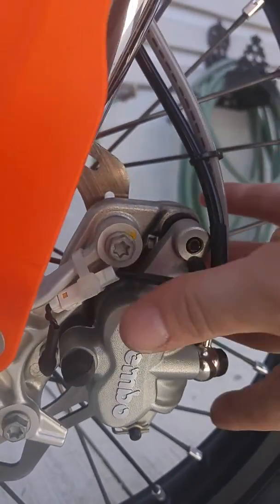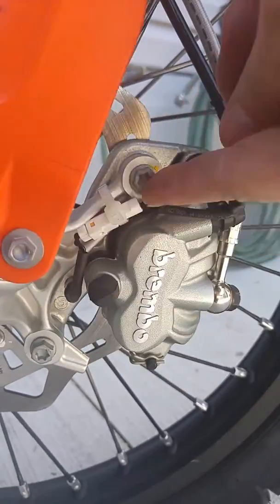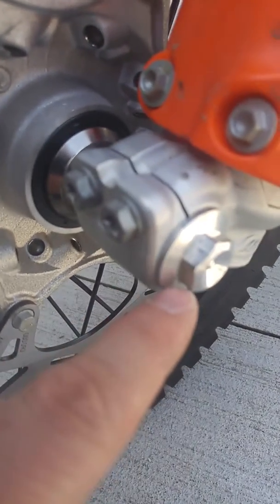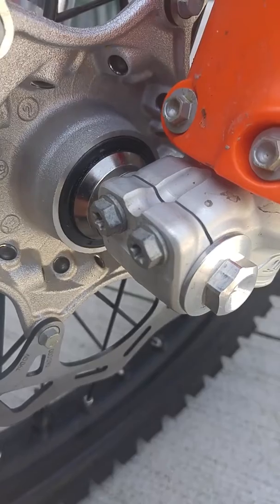Because whenever you're going to take your brake away, that's going to hold you back to this mount. So just take those two out, cut this guy, slide your brake out of the way. Come back to this guy and this guy — same on the opposite side over there. And then hold back the far side and loosen this guy, and then you'll be able to spin your front wheel nice and loose. Let's do it.